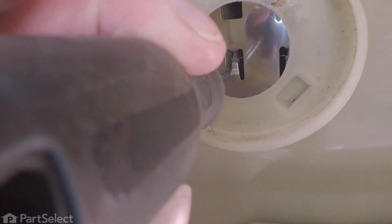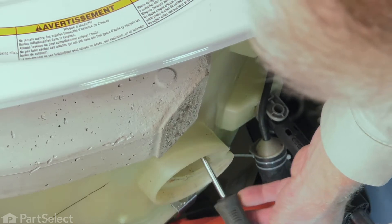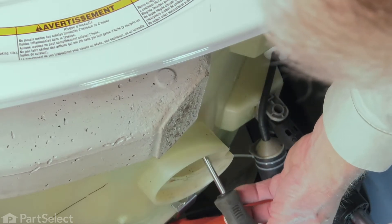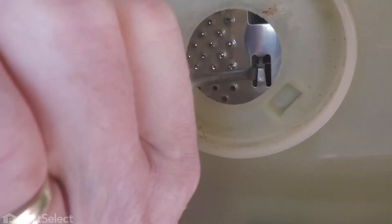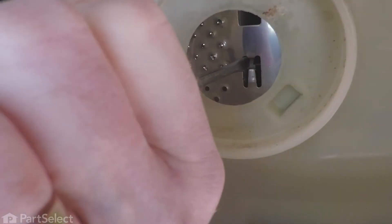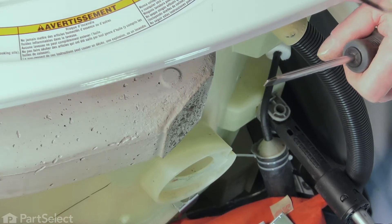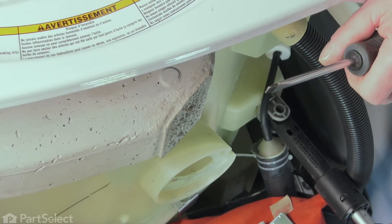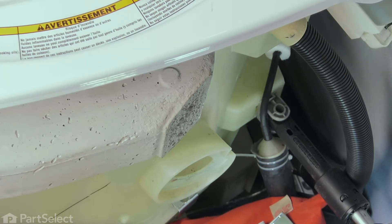There's one tab released — next we'll need to lift the separate one beside it, then lift the other side as well. Then just reach inside the drum and pull that baffle towards the front of the washer, see if it will move, and now we've got it released. Lift it away.